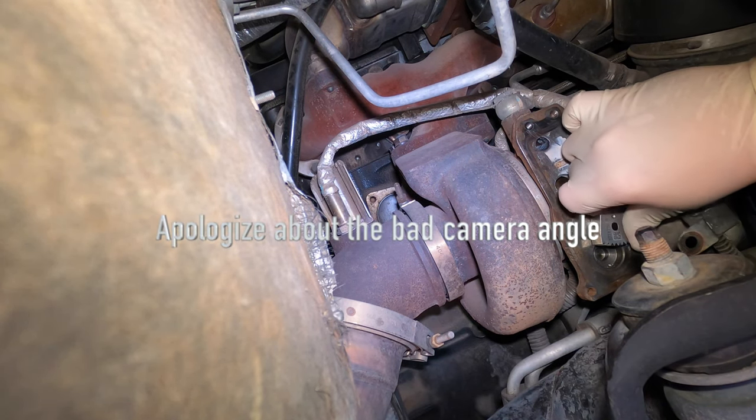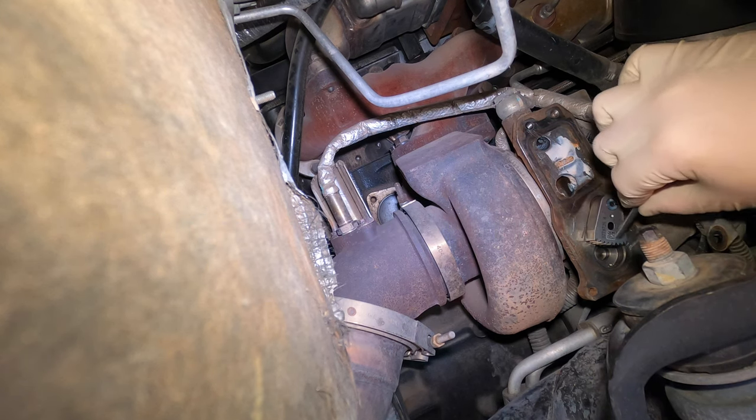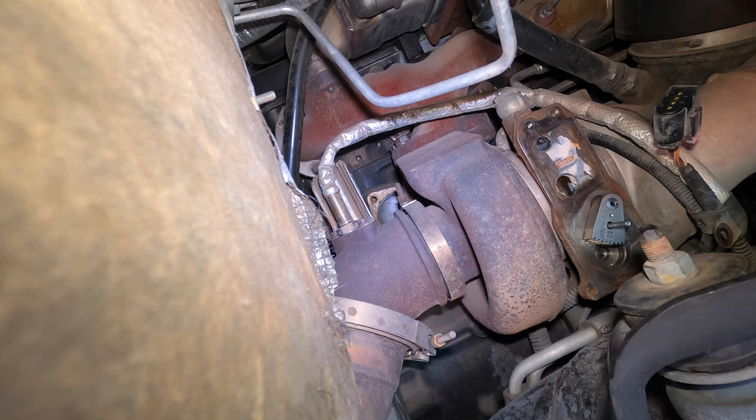Now that's all set up, you're going to have to put this turbocharger right, getting ready to install. The actuator kit comes with this pin that goes in here. When you put it in, you're basically lining up with that line right there — put the pin in, make sure it's straight, and then we're going to prep the actuator.